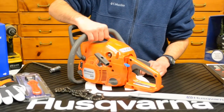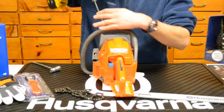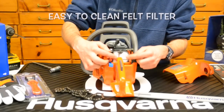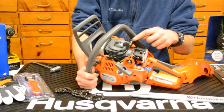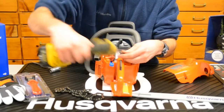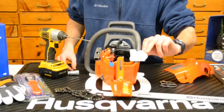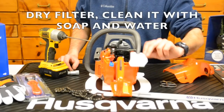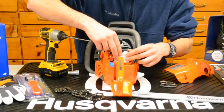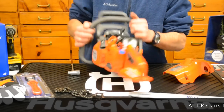Let's dive into the air filter cover on this one. It's got three screws on the top holding it on. Pull this off — here's where you can see the engine. The white piece right here is your felt filter, which is a cleanable filter. You've also got easy access to the spark plug right there. The felt filter is cleanable — you can wash it with a good degreaser like soap and water. Don't use anything with ammonia. This is a dry filter, so no oil needed. Just make sure it's clean and dry before putting it back on.